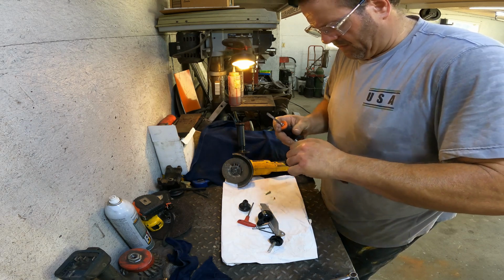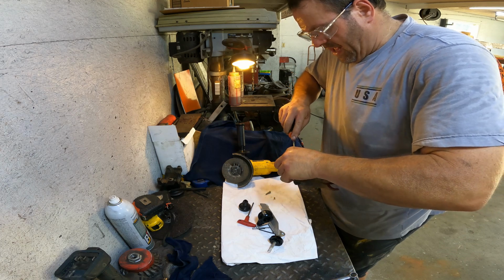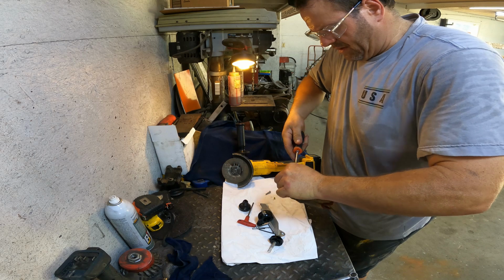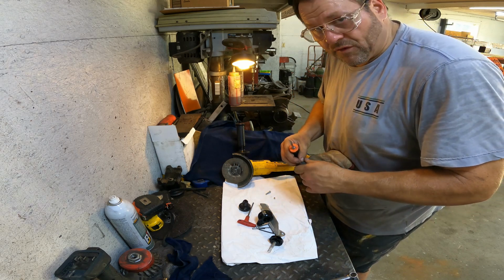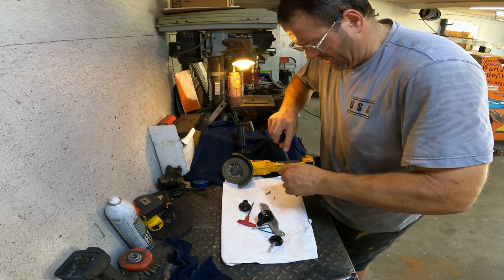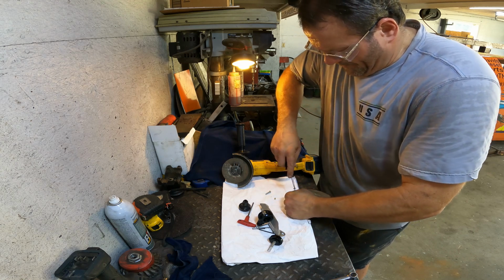I've been told several times it is much better to run a bypass fuel system, especially on E85, and the feedback I got on why it was so important was that it keeps your fuel from getting really heated sitting there in the lines in the engine bay. Its fuel's always going to be moving back.